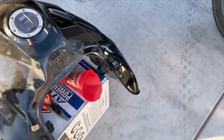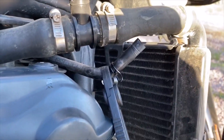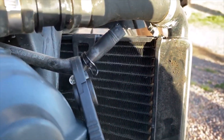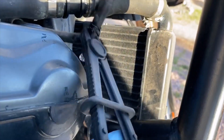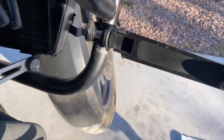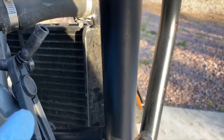I had a full tank, so I pulled this hose off and quickly put a rubber nipple on there to stop the fuel from flowing out. Then I took a five-gallon fuel jug — you put a hose clamp on there first, pull this off the spigot on the bottom of the tank, put a nipple on real quick, then get a five-gallon gas can on a pedestal like a box with a funnel.